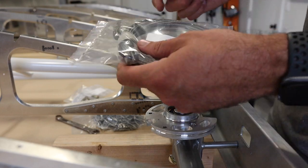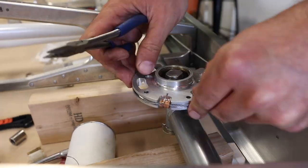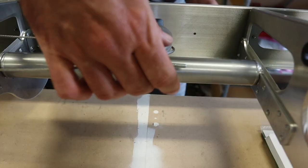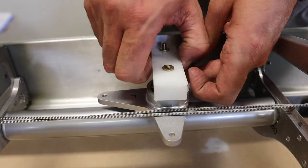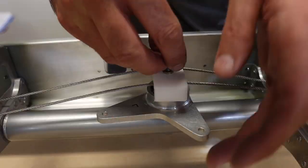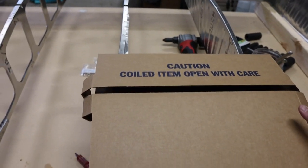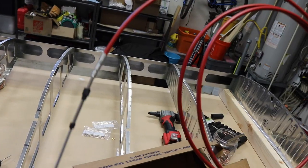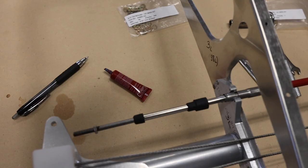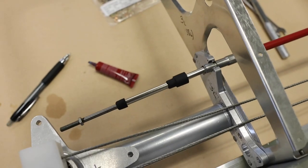Next is the aileron cable. And now here's the flaps — flat Teleflex. Two hands. It looks like it's symmetrical; this is how it works. It fits like a glove actually, once you figure it out — it's just that little gap right there. Make sure you safety wire it.